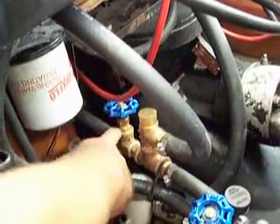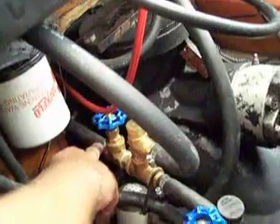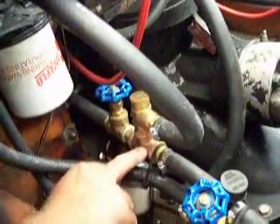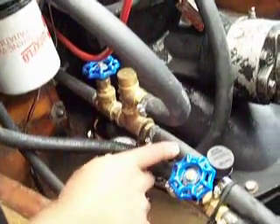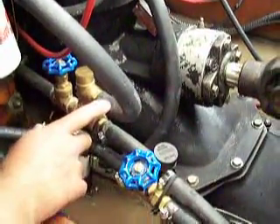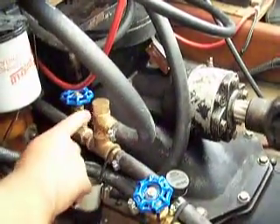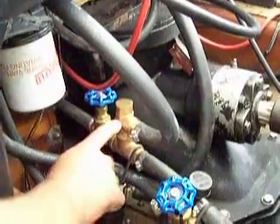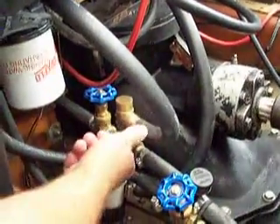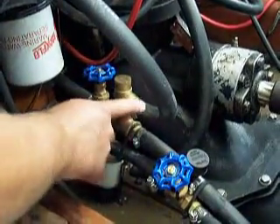The way it works: this is a jet pump, water flows from the jet pump all the way through and through our T valve to the actual engine. This is your spill — when the pressure raises above 15 psi, or whatever you decide to adjust that spring to, because by loosening it you can lower the pressure rating so that it dumps the spill sooner. They call it a spill because it's just releasing the water to the spill, which is this hose.